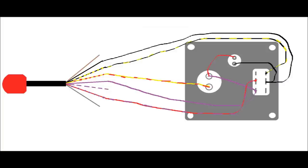At this point, you turn the switch on, the light comes on, and the starter button works. The outboard will start. You turn it off, the light goes off, the stop circuit grounds out, and the outboard shuts off. You now have a functioning kind of control panel. The problem you have now is you don't have a choke or a primer — that's kind of important to get the thing started. That's where the unfortunate part comes in: you still need to add another switch. If this was built into this toggle it would look a lot better, but unfortunately it's not.